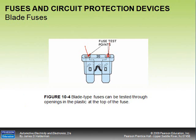That gives me a way of checking it without unplugging the fuse. Never do a visual check of a fuse and assume it's good — I've seen fuses that burned in just a very small place that you wouldn't catch with your eye. The ohmmeter is definitely the best way to check a fuse. A good fuse should have continuity between the two strips; a bad fuse would show no continuity or infinite resistance.